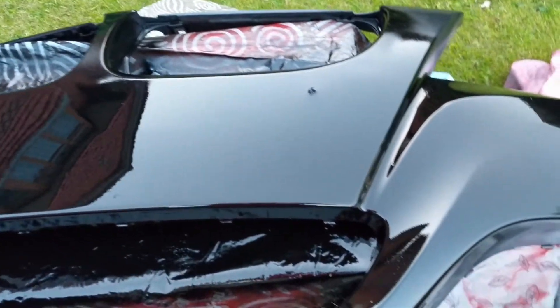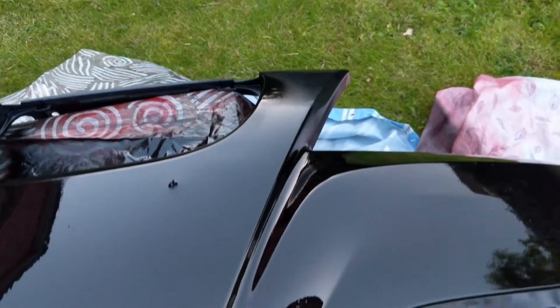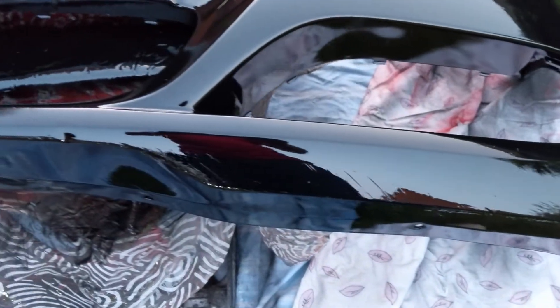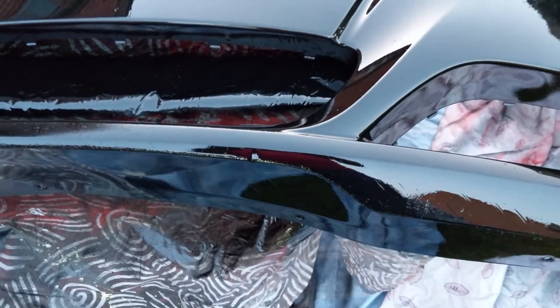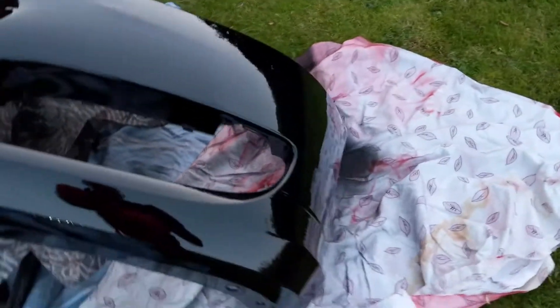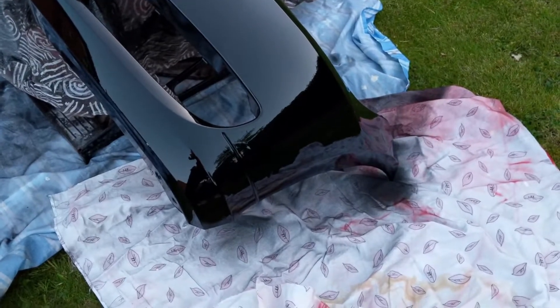That took a little more paint than I had planned. Just got one coat on there — not perfect, but it's not too bad. Can't see runs along there. Haven't quite covered it in the top corner, so I must make sure I do that with the next coat. You can see some of the dents still, but I wasn't taking those out. Along here, this is where all those scratches were and I just gave them a quick rub — it really highlights the scratches when you paint it, that's why you have to get it nice and flat. This is a direct-to-gloss paint which we're trying.